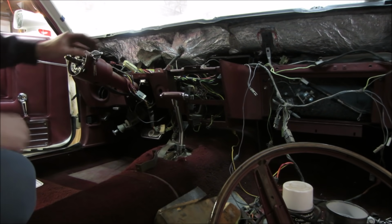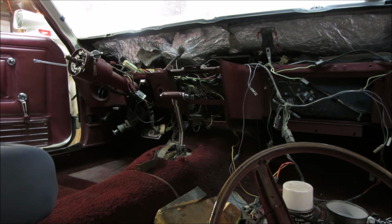Yeah, still the same thing. Even with the key, as soon as you're off a crank, there's a primary but no secondary. So something's going on with that. It could even be partly because the dash components aren't in it and it's maybe looking for feedback from something. I'm not sure. But at least we're to the point where it runs and actually sounds really nice. I'm real happy about that.